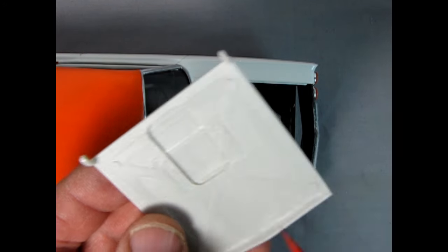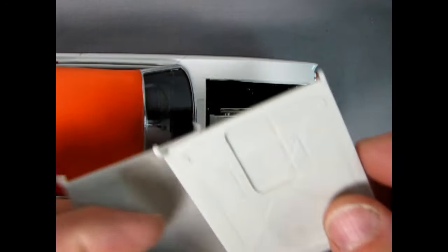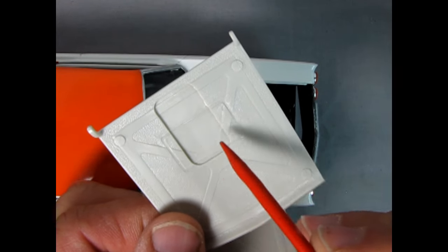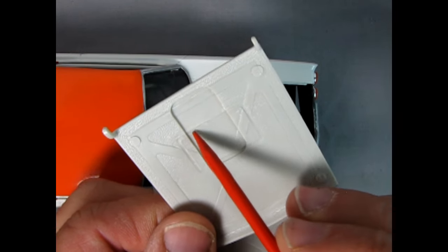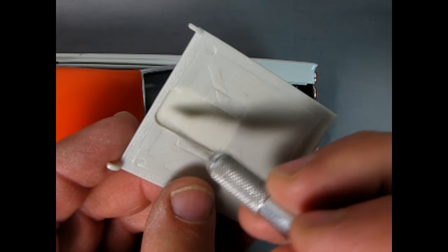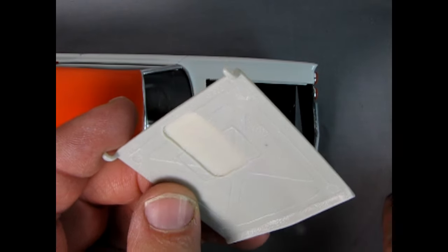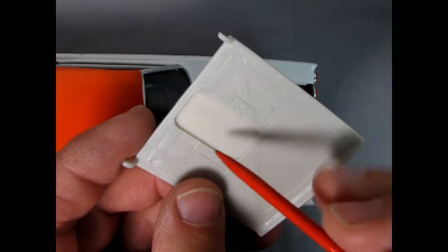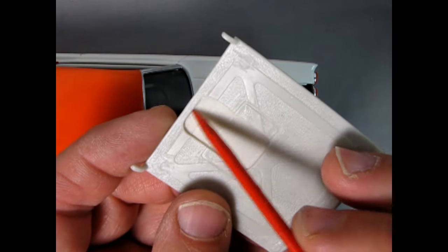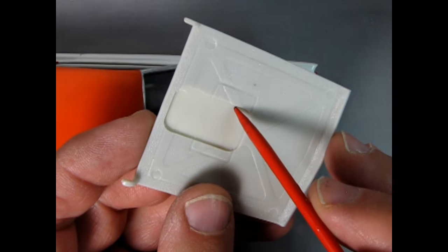back as well. Now what I did here is I scraped down, like you can see the cutout line. This is from the original dual carb setup from the 1968 kit. But there's that line there. So I did that same technique, back and forth, back and forth, wiggy waggy, wiggy waggy. And I went down below that inscribed line just a bit. And I removed the brace in here in the back and the little cross attachments there and there.